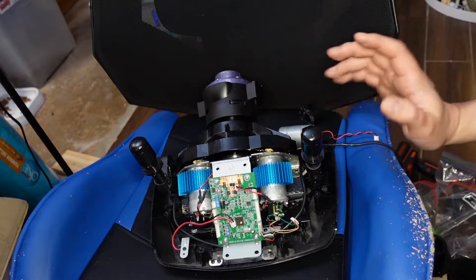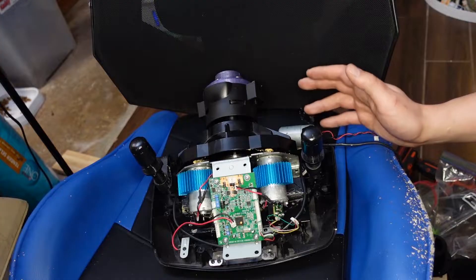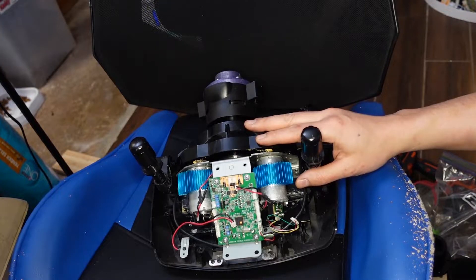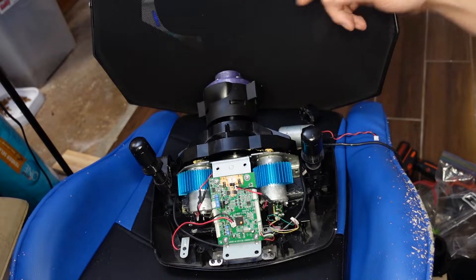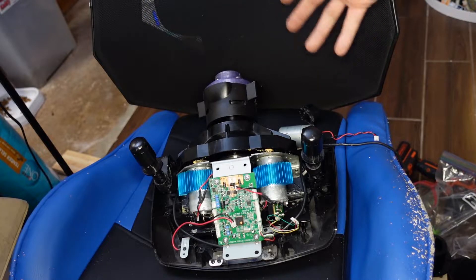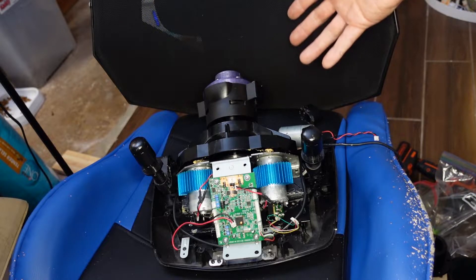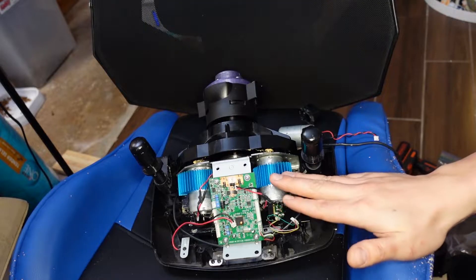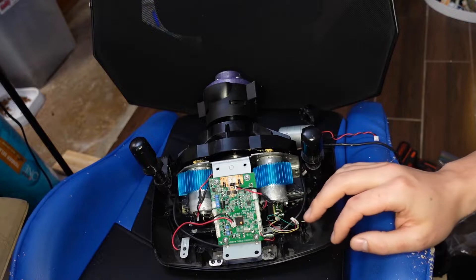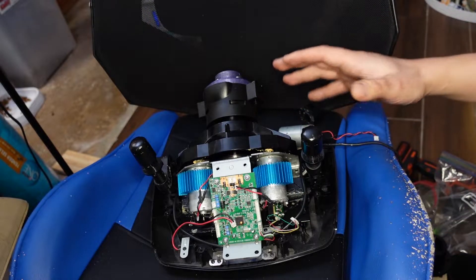The power brick doesn't make the wheel better — it simply makes it handle peak amperage better. So your regular motions won't change, but when the motors are getting a hundred percent power, the wheel will respond faster. It doesn't make it faster all around, just on peak load. And if you're going to do a motor upgrade, it's kind of a must just to get a little bit more power through it.